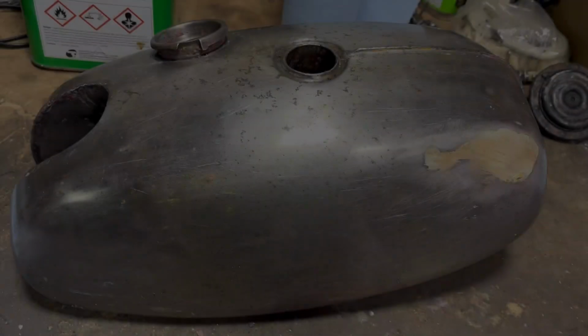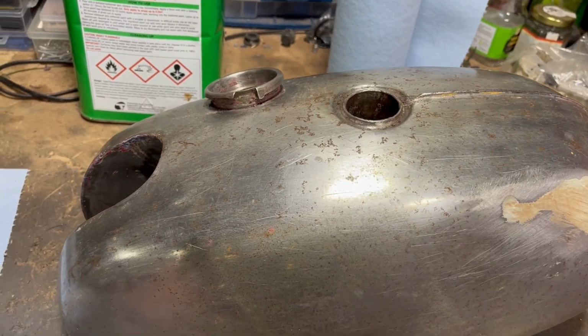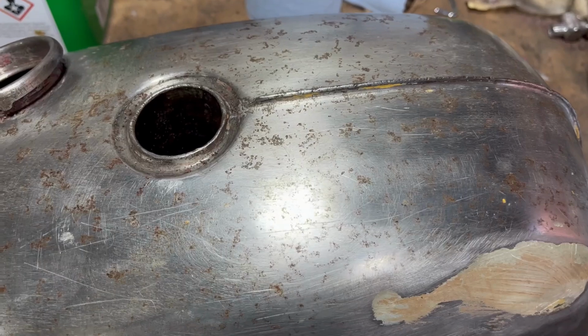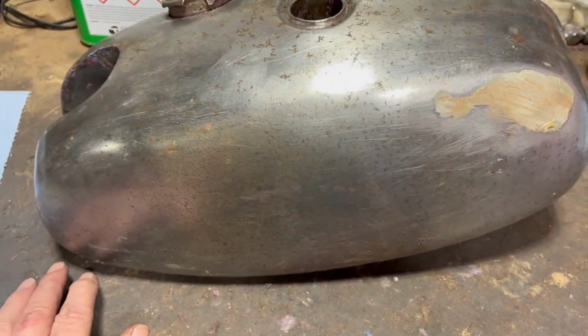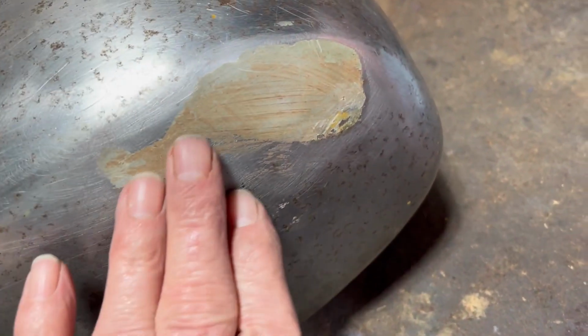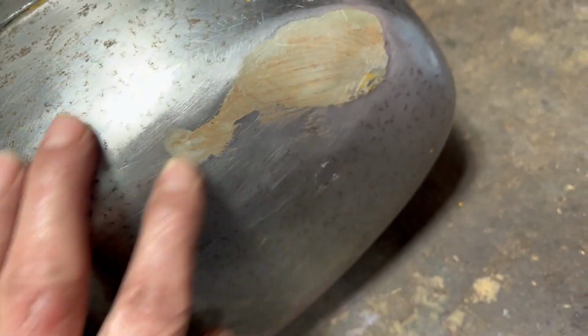Okay, keep plodding on. Right, we're just about there, I think. Just few little tiny bits and pieces just to finish this off. Basically done, and you can see the extent now of the pitting. So I'll give those a bit of an emery down, and then we'll coat it with rust proofing, rust converter. And then for these areas, as I say, I'll probably leave as is, because they seem to have adhered quite well, and we'll spray it up, rub it down, see where the low spots are, and use stopper, I think.